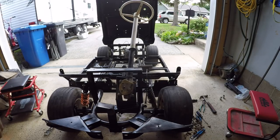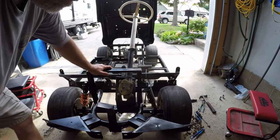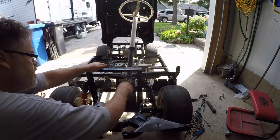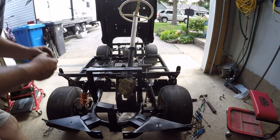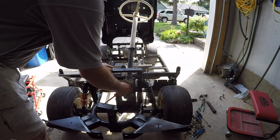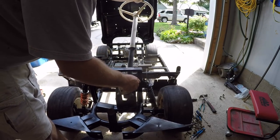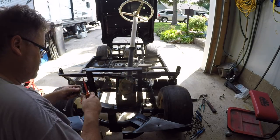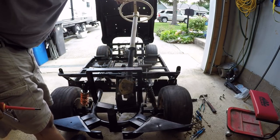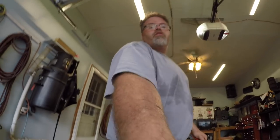A little play in the steering - actually you can adjust that too. I'm pretty sure we can adjust that right here. Let's see if I'm right or wrong. There's a nut on there - just turn the nut back and then turn the old screw down. Once you have it free, take the nut near the end, stick her in and we'll snug her out until we feel some pressure. So if anyone has a golf cart and they have a little wing nut and a lock nut on their steering doodad, that's what that's for. Just snug the steering down. Wow, what a big difference that made. That's how you adjust the steering looseness in the gearbox.